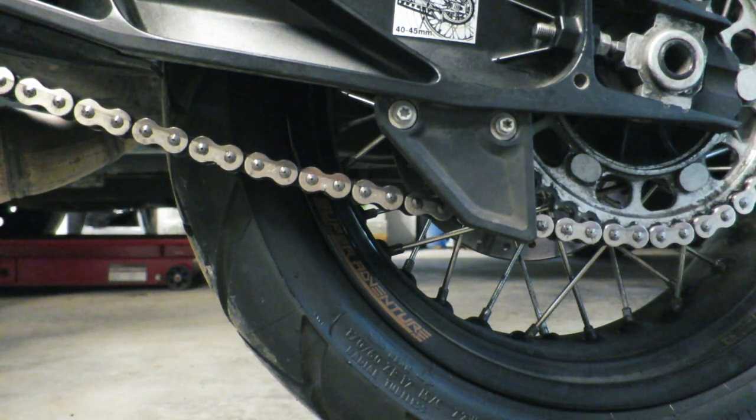And if it needs some lube, now is the time to put some on. That is how you check and adjust the tension on a motorcycle chain. It is something you need to check about every 600 miles to make sure that it's where it needs to be so you don't wear your parts out prematurely. I got to be honest, I'm a big fan of this Motion Pro tool. It takes all the guesswork out of it. It's small, it's compact, it's relatively cheap. It'll fit under the seat of my bike, which is probably where it's going to stay because I plan on doing some really big trips. If you're interested in this tool, I'm going to put a link in the description below. I am not affiliated with Motion Pro in any way — I just want to share the fact that this thing is pretty neat.